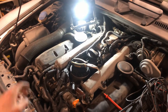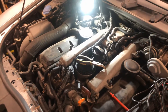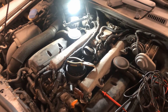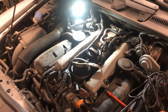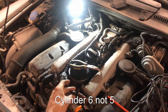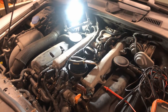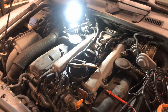With these V10s, Cylinders 1 through 5 are on one bank, 6 through 10 on the other. This one is throwing a code for Cylinder 1, so that's nice and easy up front. The issue is the glow plug checked out good, the wiring checked out good, had good power. I swapped relays and still had a Cylinder 1 issue. Just by chance, I decided to check Cylinder 5 and that one's actually the bad one. So I'm not sure why it's throwing a code for 1 when 5 is actually faulty.